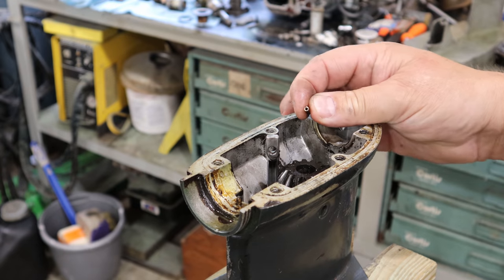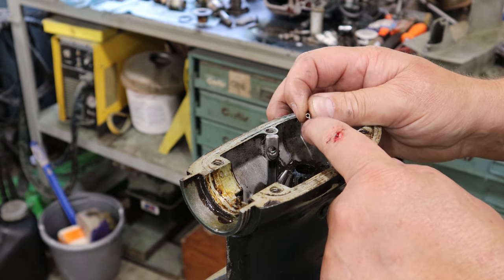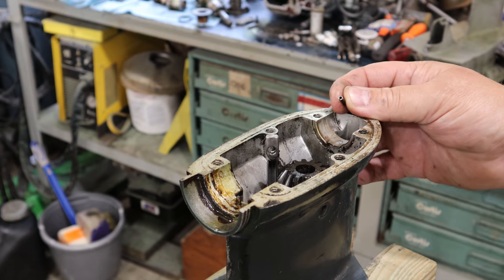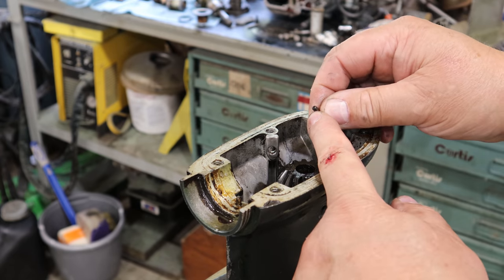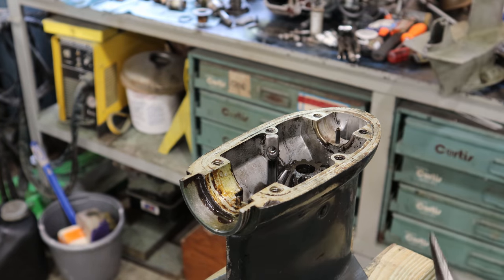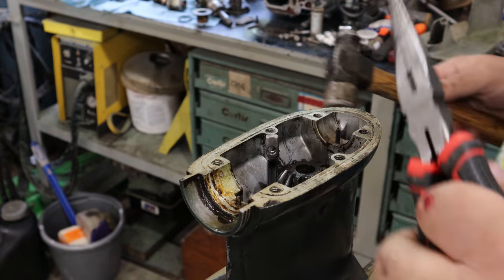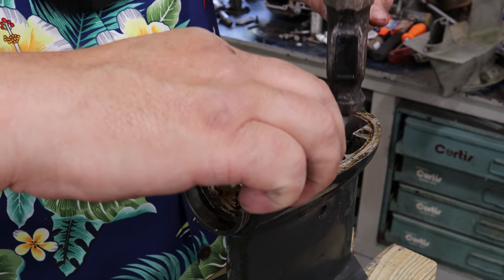Now, the other thing I want to show you is I took this over to the belt sander and I ground this off so that it was flat. I wanted a flat, sharp edge here just to get as much height, because on these other ends of these pins, they've got a little chamfer, radius, whatever you want to call it, formed into them. I'm putting this in a fashion that the slot is perpendicular to the shaft. Now I'm gonna hold this carefully. I'm gonna see if I can get in here without blocking the camera shot. Get her to tap down in there, started.